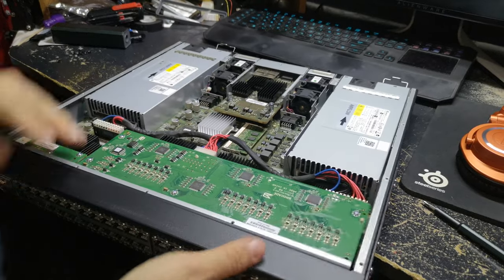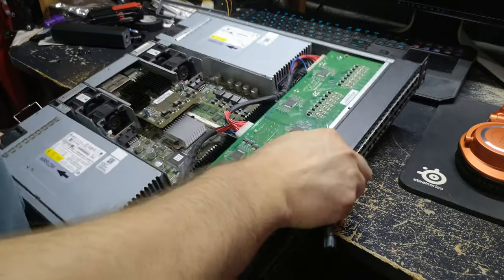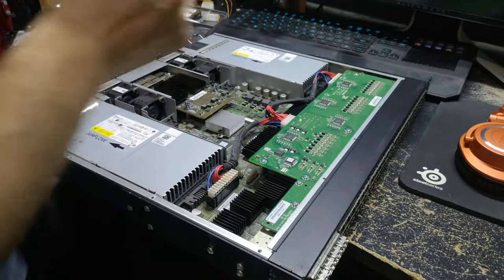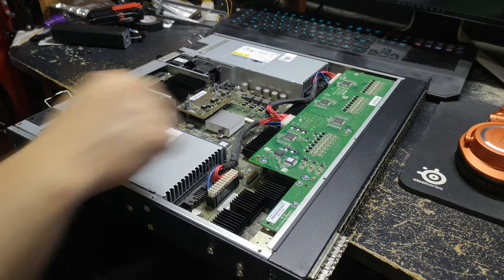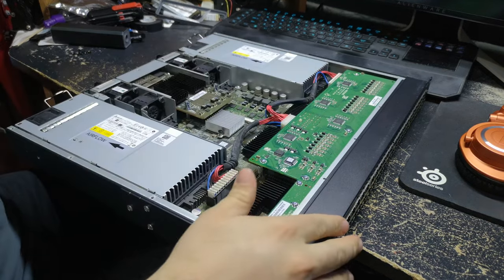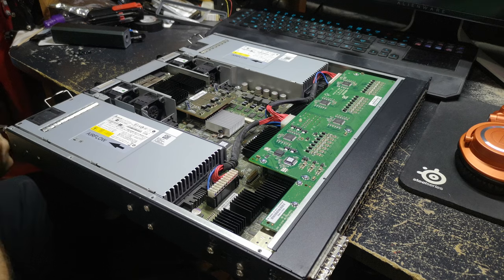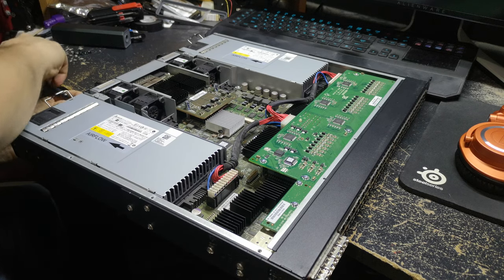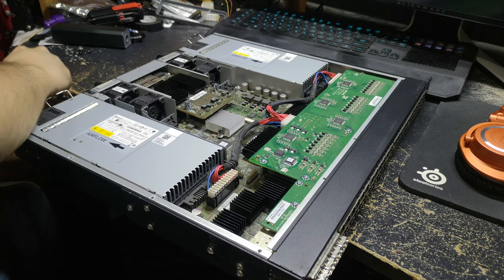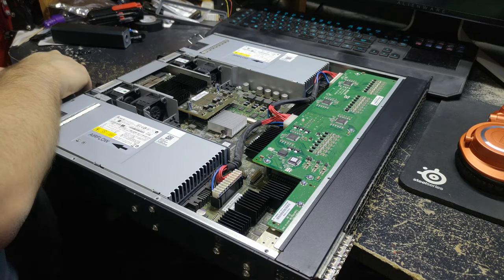Yeah, that's definitely the hot spot. So something is wrong with the central heatsink there. So I'm guessing that is the CPU. And then we're going to have some sort of processors, coprocessors for the actual switching in the front. Alright. Well, this will be interesting. It'll be more than I wanted to do on it for sure, especially because I just got the thing in.